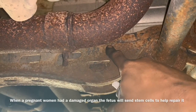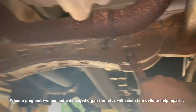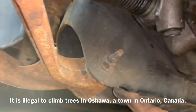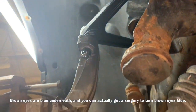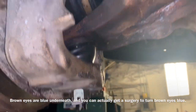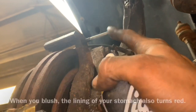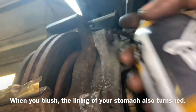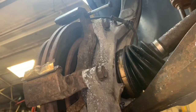I'm going to take penetrant and spray it on my nuts and bolts. This is an 18 millimeter here; the nuts back here are 24 millimeter, could possibly be one inch. Upper ball joint, lower ball joint. We're going to remove the 13 millimeter bolts that hold our caliper to the bracket. It's not necessary to remove the bracket but you can — it will make it lighter.